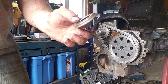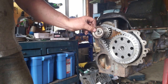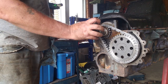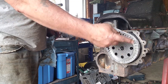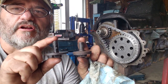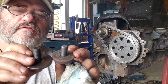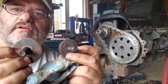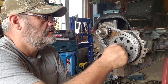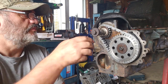Check the straight edge again and we're golden — we're timed. That's how easy it is. On the crankshaft side you've got a little oil slinger with a keyway — notice it's shaped like a dish. The purpose of that is to keep oil from going out toward the seal on the timing cover and allow it to drop back into the pan; the timing chain picks up a lot of oil. There are two bolts here with the same thread pattern but two different washers — one short fat washer and one bigger one. One is for the cam, one is for the crank. The crank bolt goes in later to hold all the pulleys and balancer on. Make sure you put the right bolts in.